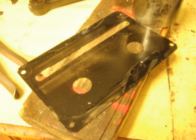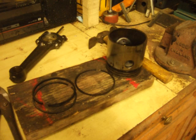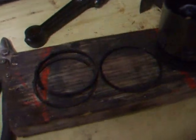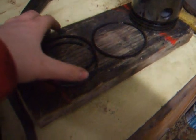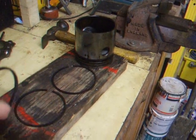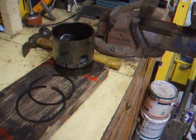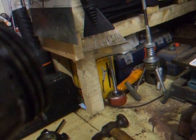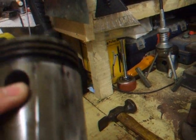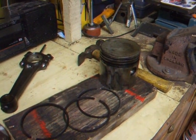Just going to start cleaning up the piston and this plate and a few other little things. We just popped the piston rings off the engine. They look pretty good - we're obviously going to have to measure them in the bore. The oil control ring is incredibly dirty, but the compression rings aren't too bad - they're pretty clean. The oil groove is a little bit dirty as well, but none of them look too bad. We're just going to go ahead now and decarbonise and degrease the piston and see what it looks like then.